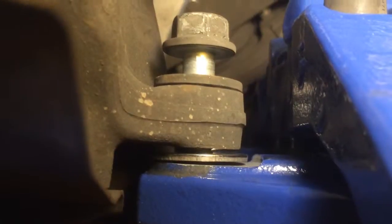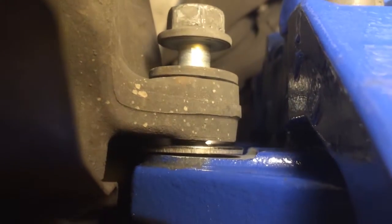We're doing a front caliper here and you can see that silver — what looks like a washer — basically it is a very precision washer. It's standing out the caliper just enough to keep it from scraping. Once it's mounted, it gets pretty tight and it's perfectly safe, as long as the two washers are the same thickness as each other all the way around. That's why you've got to buy precision ones from McMaster-Carr.